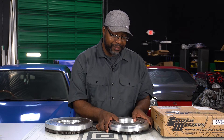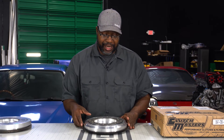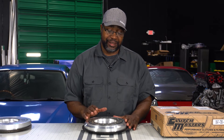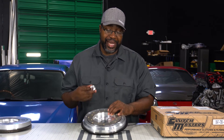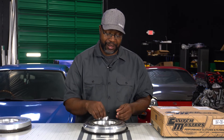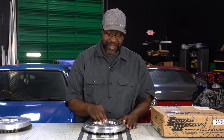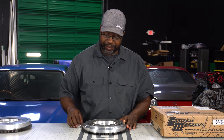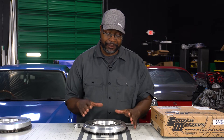Beyond the fact that you're going to be able to hold more power, the twins do share one primary component that interchanges between the two: it's the same starter ring gear. More importantly, we use the exact same pilot bushing adapter on both kits. All of my flywheels, except for the BMW ones, use the exact same pilot bushing. So if you ever decide to upgrade from a single disc — say you're maxing out the power and want a twin — the pilot bushing setup is identical for the center bore on the flywheels.